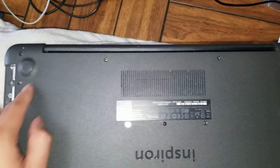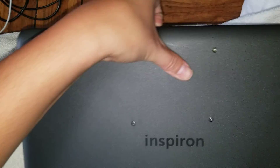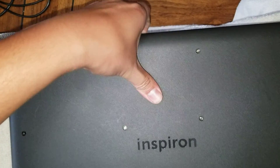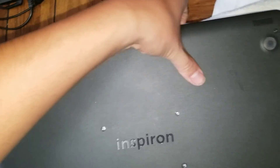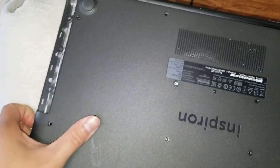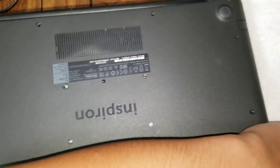Be careful because a few of these screws help hold the hinge in place, so you don't want to put too much pressure opening the hinge. What you want to do is open it — you'll see the gap here. Get your fingernails in there, and while you're pulling with your fingernails, push with your thumb down and it'll pop all around. It'll make a kind of loud pop — it'll sound like it's breaking, but don't worry, you're not breaking it. That's just how it is.